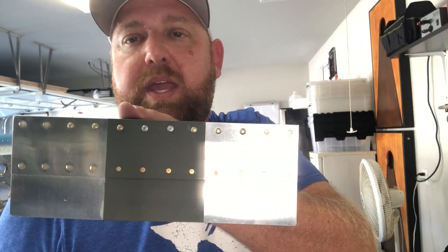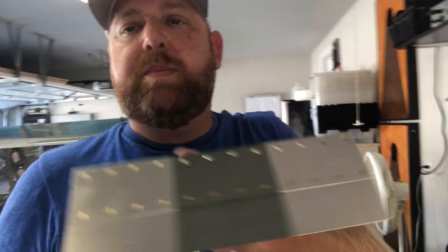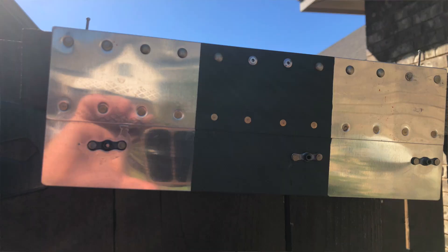Hopefully I don't die because I didn't prime my airplane and it fell apart in the sky — what a sad way for Ryan to end his life. The 182 that I fly is a 1977 182, and it is not primed and does not have any corrosion. I plan to take very good care of this airplane, so I think we'll be okay. As a test, I'm going to put a nut plate in each of these three sections — the Corrosion X treatment, the primed, and the non-primed — and stick this back outside to see what happens. We'll check back periodically; it probably won't matter for like five years, but if it starts to corrode then, I've got a problem in the airplane.